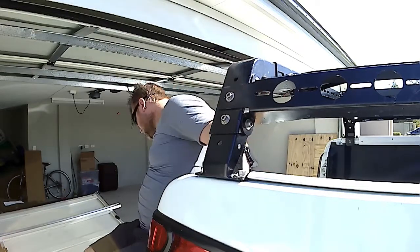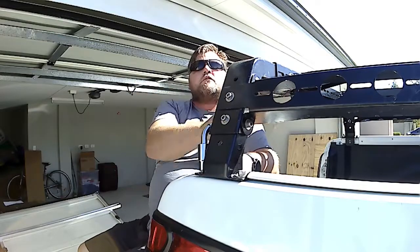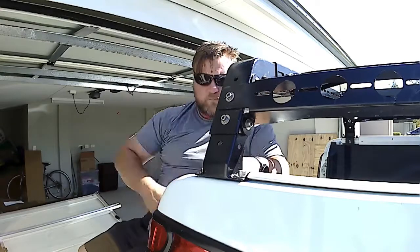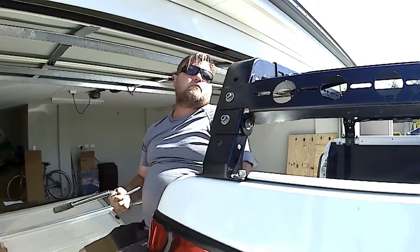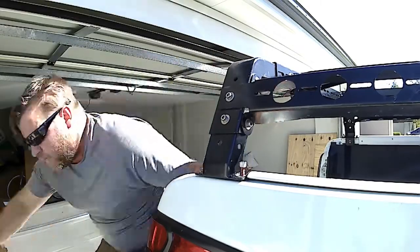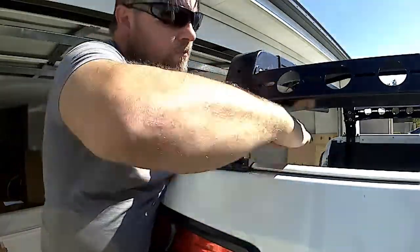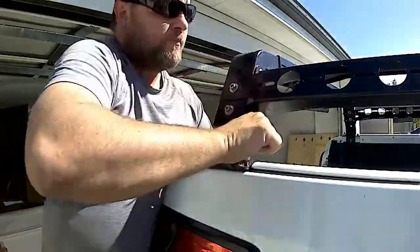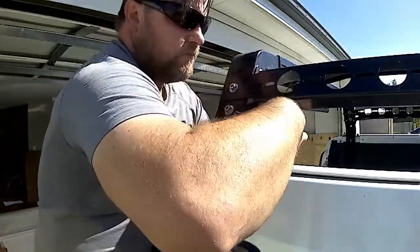It's easier to do with a socket wrench than a normal wrench, this sort of stuff, but you know, if you don't have the right size, then a wrench or a shifter or something like that will do. But yeah, getting the Allen key and wedging it underneath there is the best way of getting it to go up, and using the short bolt. So that's the long bolt, that's me. So I'm using the same socket wrench, so it fits in that gap, and I pushed it right up, and then I basically tighten up those long bolts.